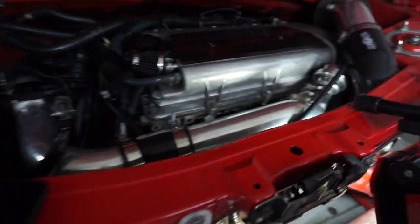Draining all the oil — my gauge said 2,400 miles since I last changed it. It's pretty dark. Turbos actually make the oil get dirty quicker. I'm glad I'm changing it. I'm probably gonna change it every 2,000 miles with the 2ZZ turbo setup — 3,000 might be fine but this is just shy of that and it's pretty dirty.